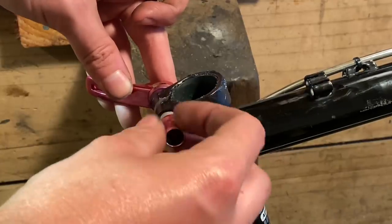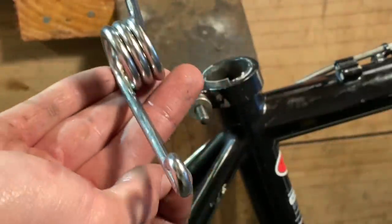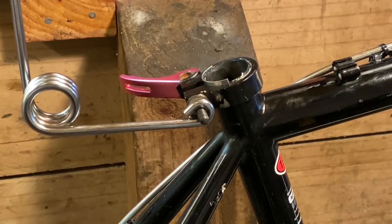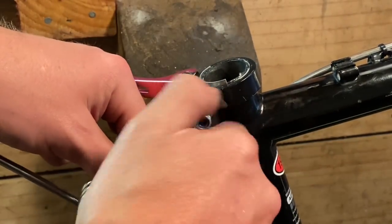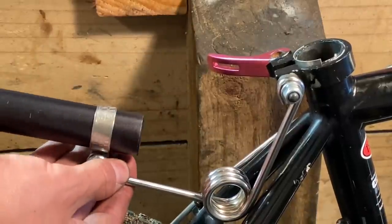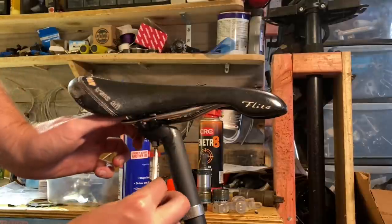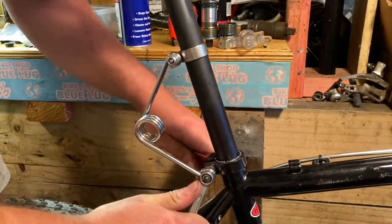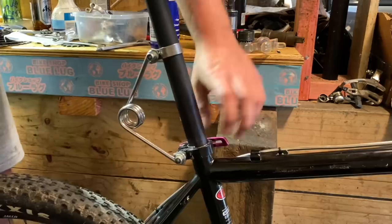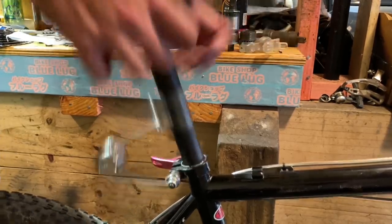You grease the seat post and it slides up and down nicely. This is the second Height Right I've used and I really like them. The only thing with this bike is I don't have a quick release seat post clamp that fits, so that's why you can see that shim there — it's the only thing I could make work. I think I'll have to find something better suited so I still have that lip around the top of the clamp. It is a bit of a strange size to find in quick release form, so I'll probably have to modify something. But this works for testing for now. See, it goes up, it goes down — now that's installed, it's time to go ride it.